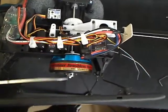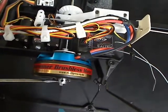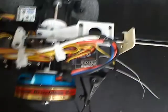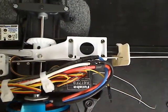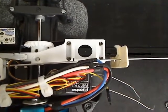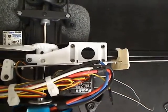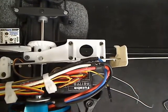Directly underneath the motor, you can see the piece right there. There's three allens on it. You've got a hole right over here, which is part of the tail assembly, and inside that hole you'll find two allens. You've got your main gear, and on the main gear, front and back, there's two allens. Go ahead and loosen those up or take them out.